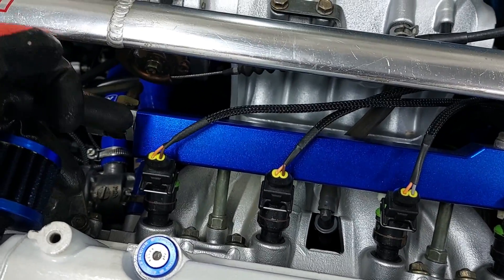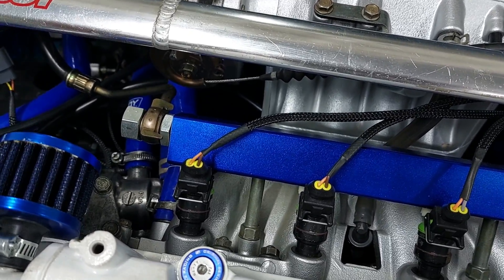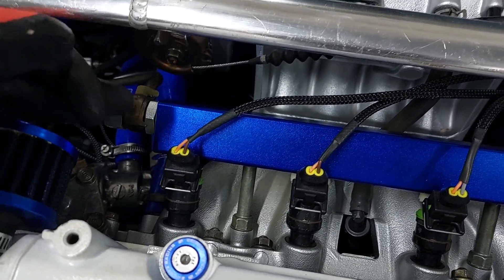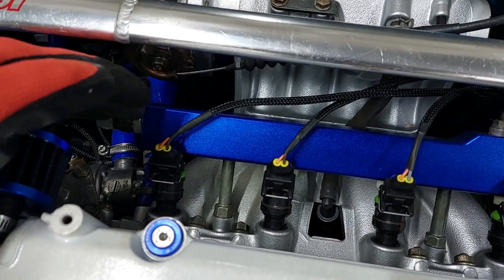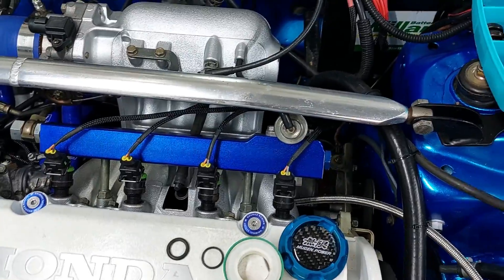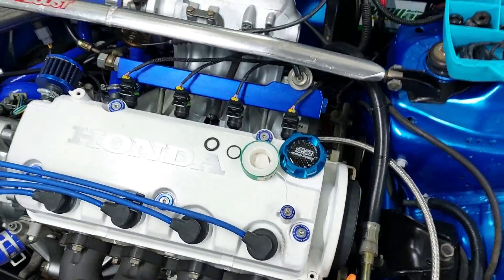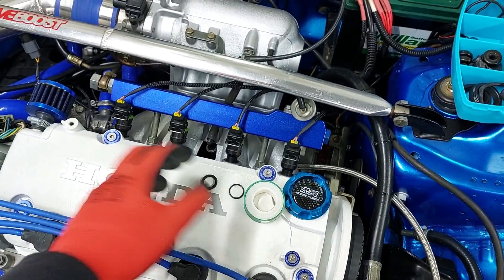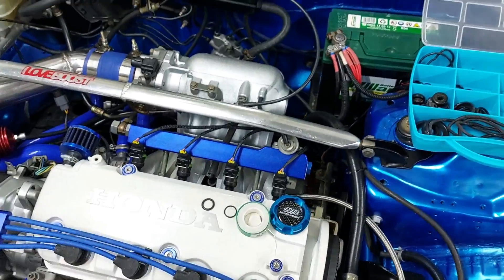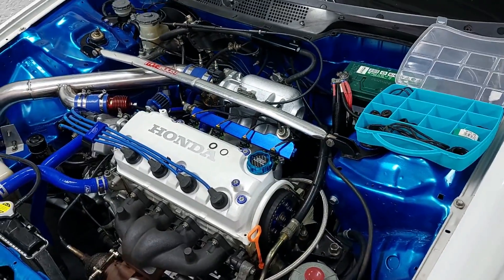I also drilled out this fitting — there's a hole in the center that was a bit too small, so I drilled it out by one millimeter. I also drilled the hole through the feed end just to make sure there's no restriction. I've been running the car and checked the spark plugs — it works, the plugs are now burning evenly, so very happy with that. Apart from them giving you the incorrect O-ring for the setup, I would recommend this part — it's quite cheap and very effective. Please like, comment, subscribe, thanks for watching, see you in the next one.